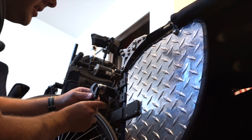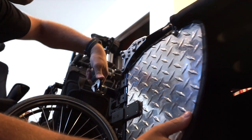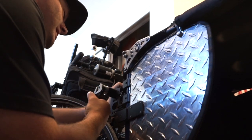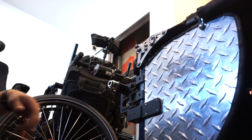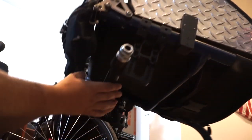Spring washer and flat washer are still in here, so we'll screw this back on. You want to get these good and tight — they're fine thread so you don't want to go crazy with a breaker bar, but you want to make sure they're not going to spin or rotate at all. I just get them as tight as I can by hand using a half-size wrench, so you don't build up too much torque and break things.